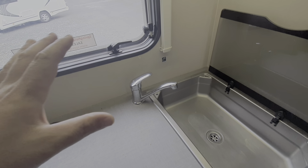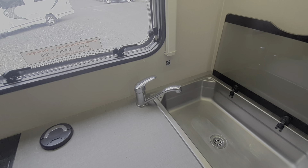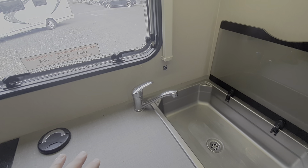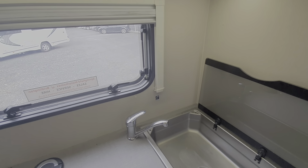If you try to switch the boiler on without priming the water system on the hot side, you're just heating thin air in the boiler, which can damage it. So it's important that you prime the water system and get it full of water before switching the boiler on.